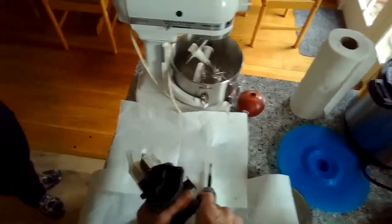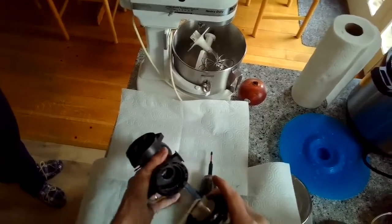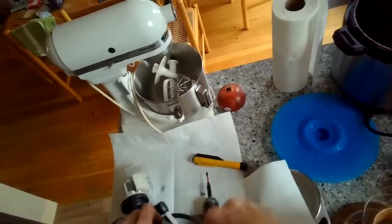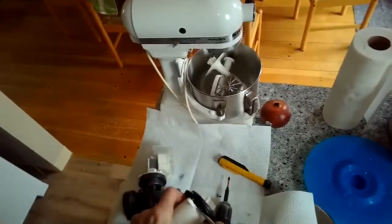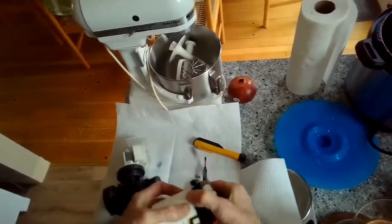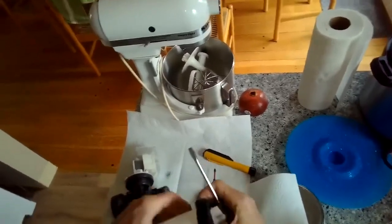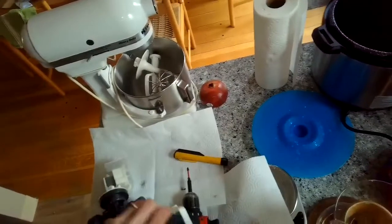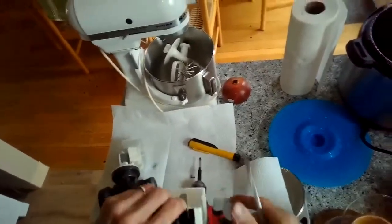And then there's like a plastic case or sheath that surrounds the drain motor, and I'm going to pry that off with a standard head screwdriver. Just be patient with this. It might take a couple of tries, but it will pry off. We want to put that same plastic sheath over the new motor.